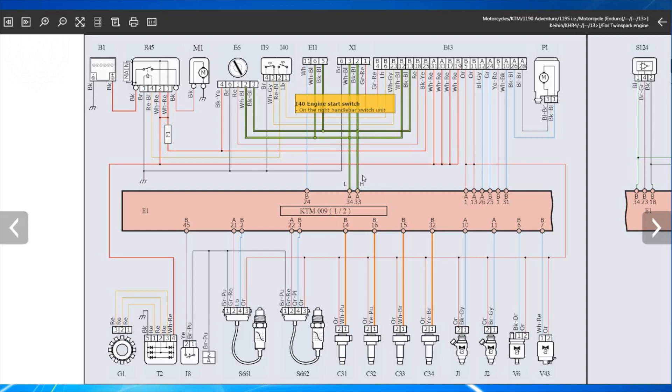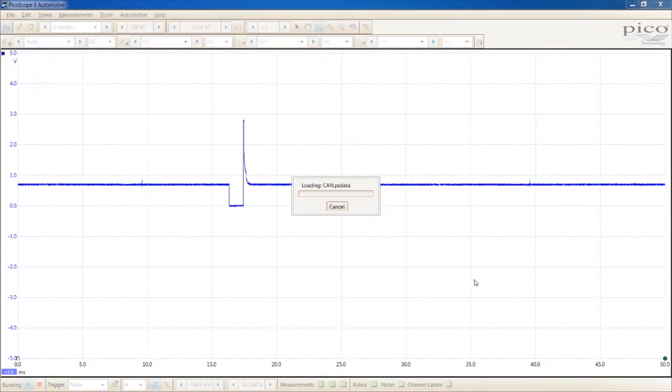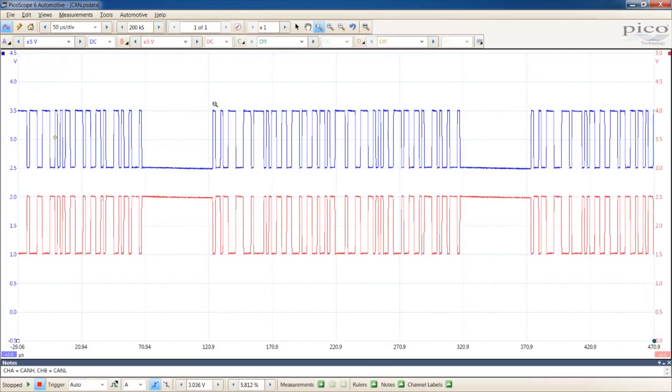These networks connect all these different components. They talk using a pulse width modulated signal. We're looking at a PicoScope now - I've got my Snap-on Vantage Pro which is a two-channel oscilloscope, great for out in the field, but this is a PC-based oscilloscope which is way more powerful but a little more finicky - the sort of thing you only really use in the workshop. This is what a CAN network signal looks like.